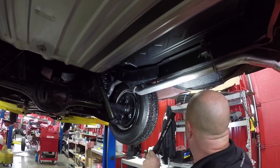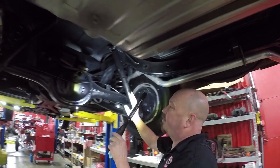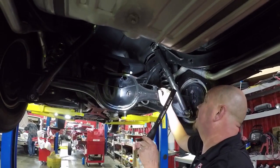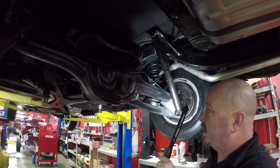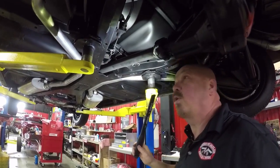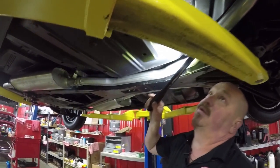Back sides of the fender skirts look good. Those inner wheelhouses look real nice. Drop downs all look good. Right around a 342 gear in here, and it is an open rear end. Looks like new shocks here too, new bumpers. Now on the brakes, I see brand new wheel cylinders there. The guys here at Vanguard will take those brakes all apart, make sure they're in good working order. Looks like we've already done it. All this exhaust looks brand spanking new.